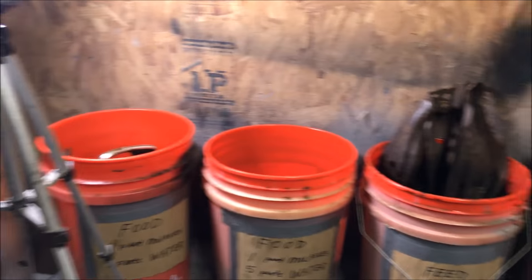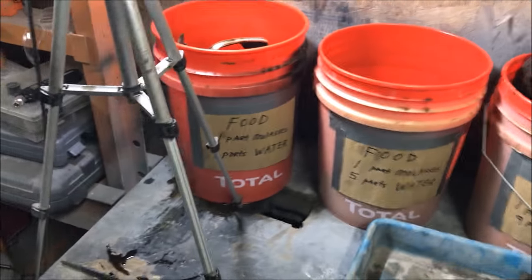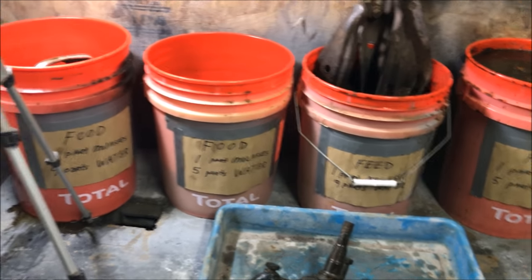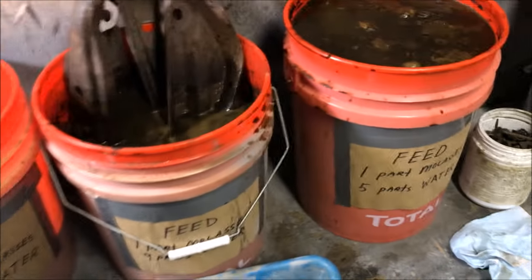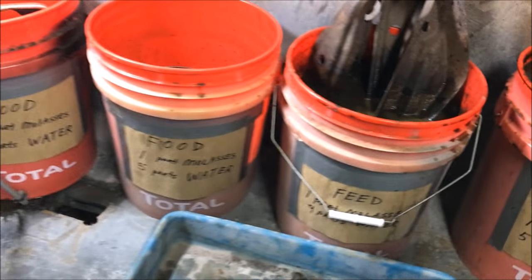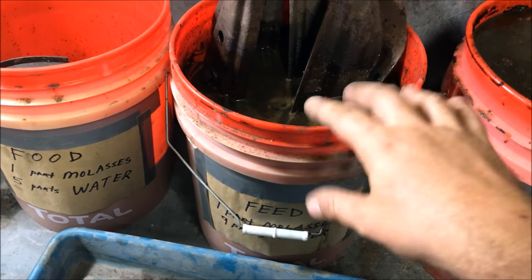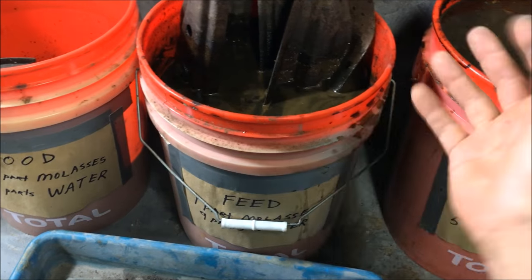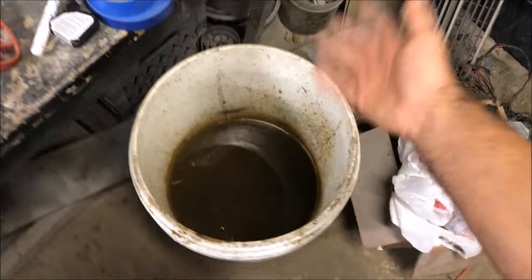This video has completely changed direction. I'm not trying to show off a magical act — I'm trying to put this process in perspective so you know what to expect. I was fooled by YouTube videos acting like this was a 2-3 day process. It's not. This stuff has been here for three weeks and it's not even halfway done. The rust is iron oxides — two parts iron, three parts oxygen — and the molasses is breaking that bond, leaving iron in suspension and releasing oxygen as gas. It does work 100%, but the ratio doesn't really matter.